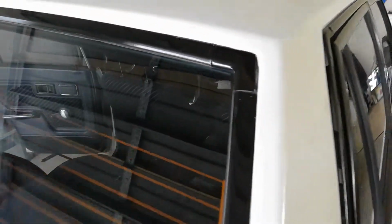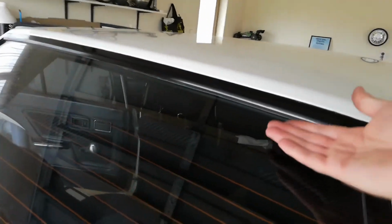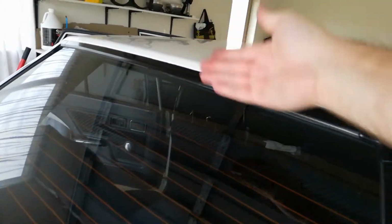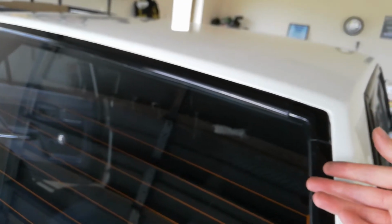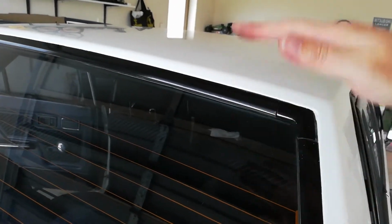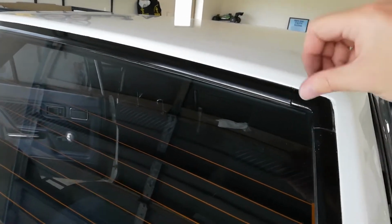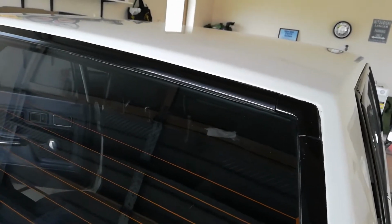ceiling. So I took it to an upholstery place, and what they actually had to do was for each of those metal retainers, about 4 or 5 of them on the front and the back, because they were ripped out of the cardboard, they put another large piece of strong paper or cardboard material over top and glued it down. So then there's a much bigger surface area to hold the clips in. They said they tugged on it really hard and they couldn't pull it apart, so that should hold up for a while yet. Hopefully I never have to take it down again.